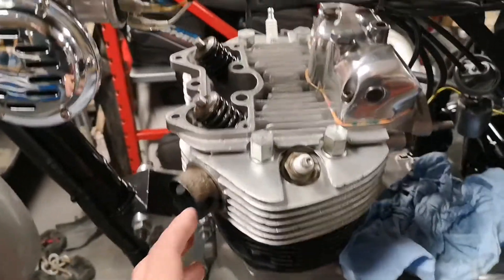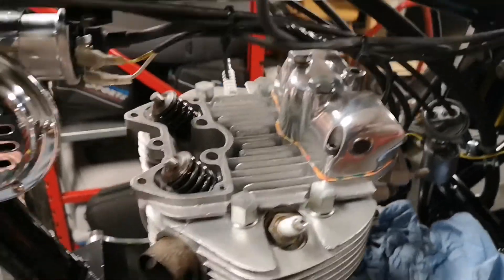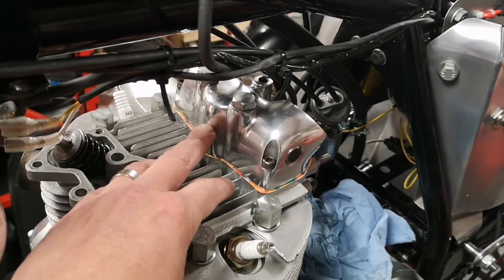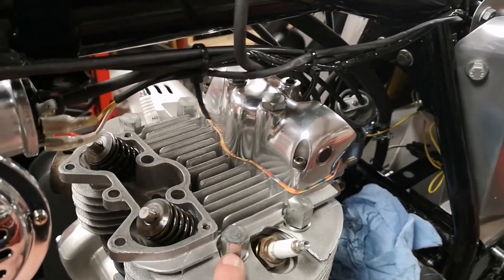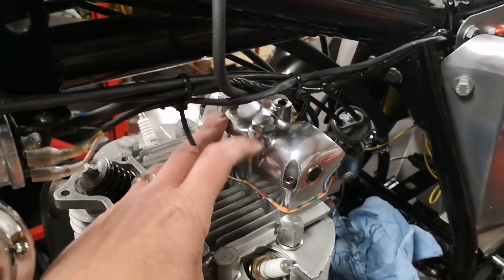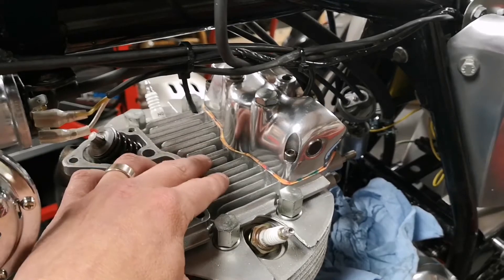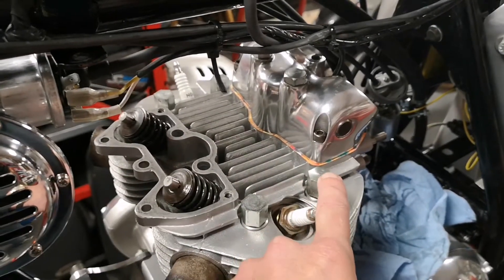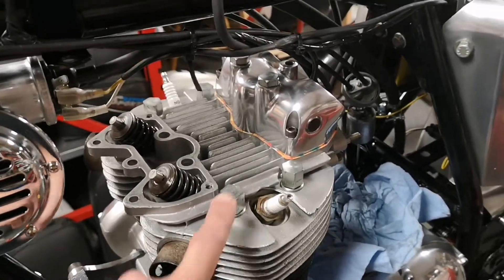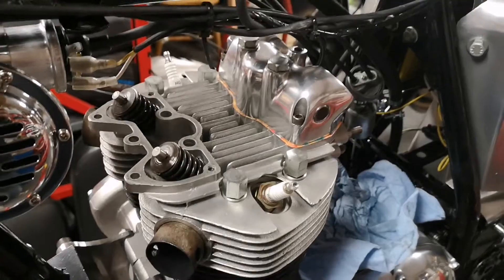Right then, the head is on. It was a bit tricky getting the head bolts into the rockers but I managed to jiggle them on. The challenge was getting the pushrods to seat in the cups but I checked and that seems okay. The head bolts are still very loose so the head still has a bit of play. I'm going to tighten the centre bolts first since the head gasket leak was in the middle — maybe it couldn't seat properly before. Worth a go anyway. That was the hard one — now doing the exhaust bolts.